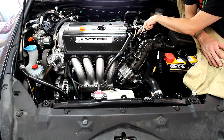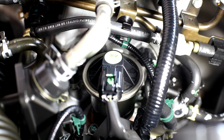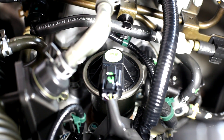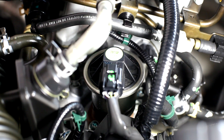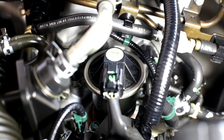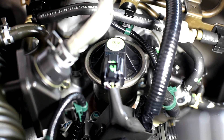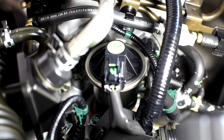Back here is our EGR valve, which stands for Exhaust Gas Recirculation. What it does is reintroduce exhaust gas back from the exhaust into the intake manifold. This effectively lowers combustion temperatures and reduces emissions — it's totally for emissions, although if it's malfunctioning it will likely affect performance as well. It shouldn't require cleaning or maintenance; it has large passages that are unlikely to get clogged, unlike older designs where they were very small and did get clogged.